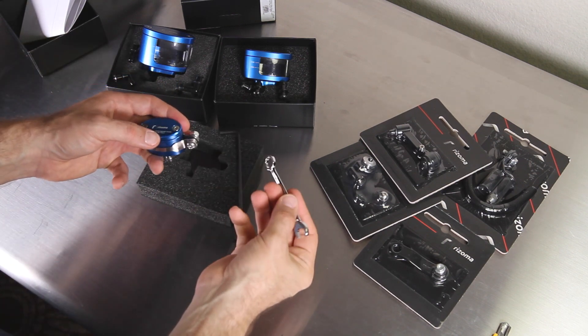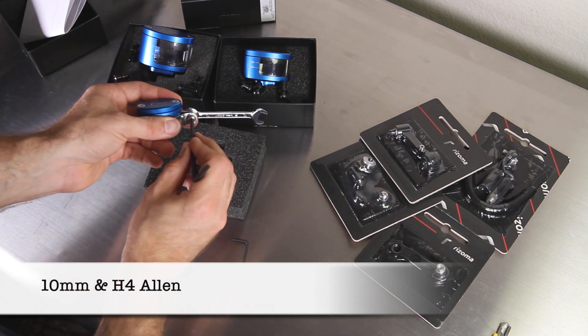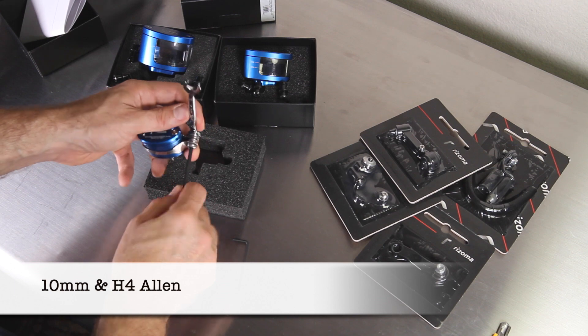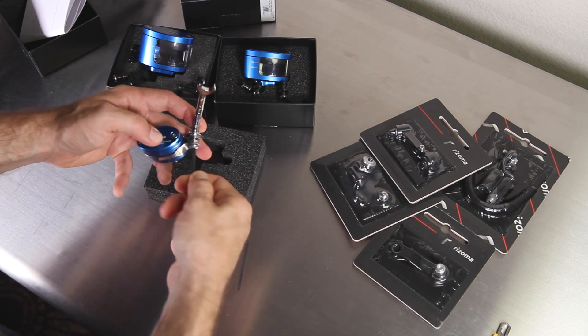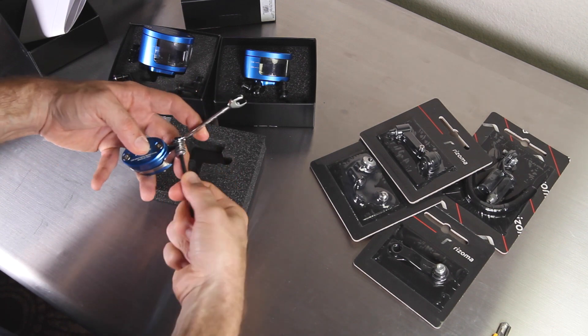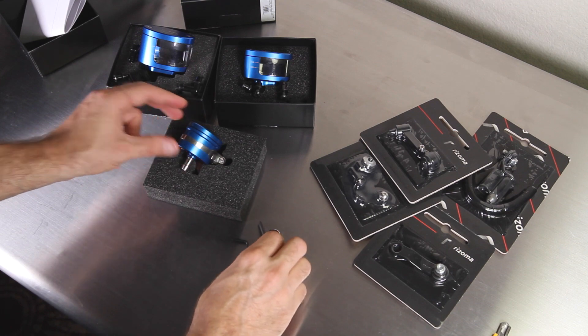To mount the CT-115, all you need is a tab to strap this to. This bolt is a 10mm and this is an H4 Allen. Just use this bolt to mount and this will really clean up your back brake setup. In order to mount the CT-125 and CT-127, you will need to order brackets, which are sold separately.